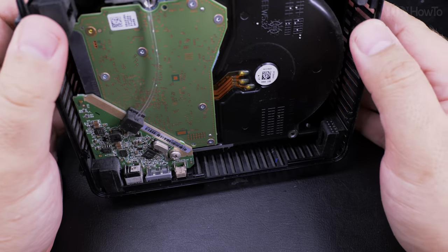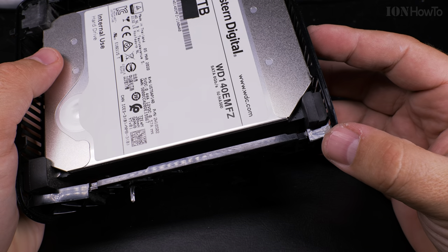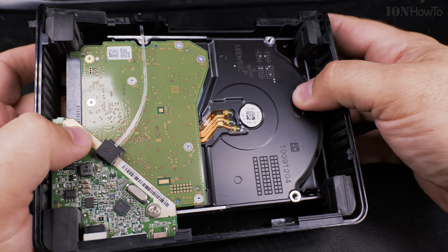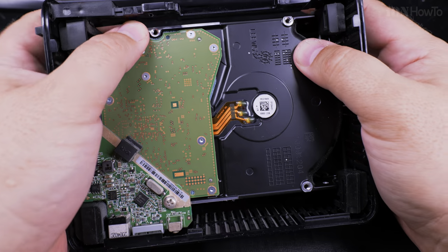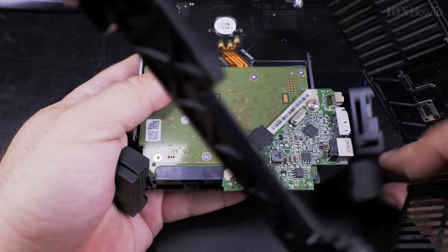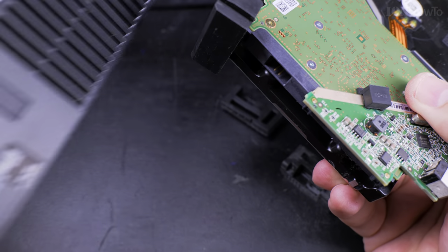To remove the drive from the case, you see those corner rubber grommets. If you ever want to put it back, you should take a picture or save a link to this video. The position of these rubber grommets is a bit difficult - they really make it difficult. The WD MyBook is much easier to open; the Elements is a bit of a nightmare. This is the light guide for the LED - it guides the light from the LED inside the board to the external case. Press the disk out from the side opposite where the ports are, and that for sure makes it easier.